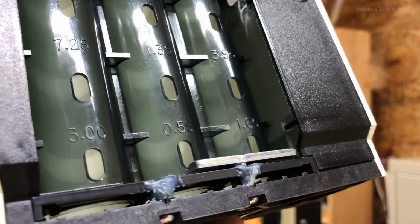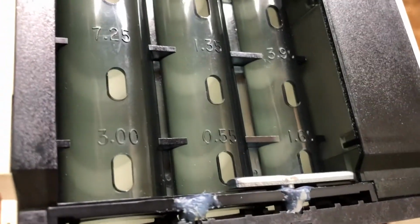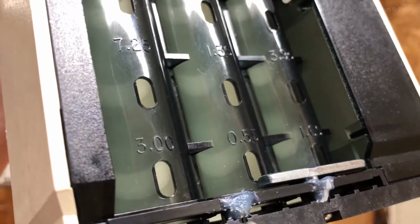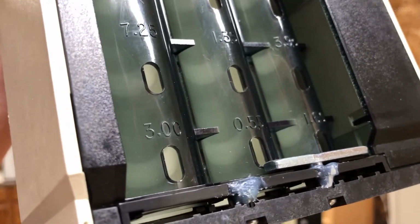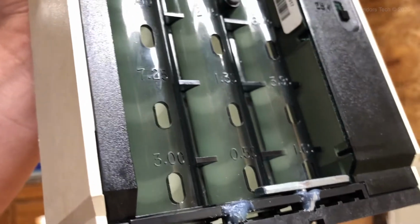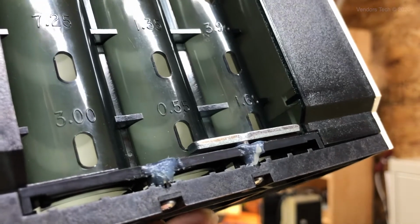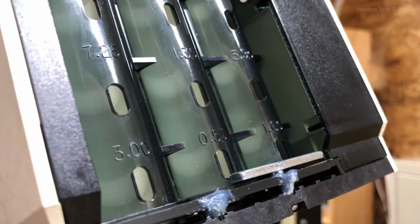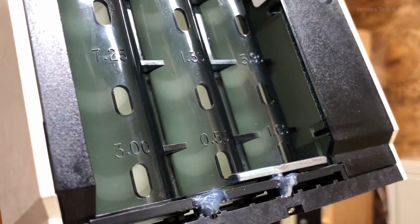And so most of the housings, like those first two I just showed you, are totally ruined by the time they get here. This one is one that I just recently did today, and there were nice cracks in these two screw holes on this housing here. But this is a special plastic epoxy. I use it constantly in all kinds of other applications on coin mechs and bill acceptors. It's a very high strength epoxy, and the cracks were insignificant enough, and I could get the screws back in and they were able to hold on to plastic, that I was comfortable using this epoxy to hold these screw holes together.